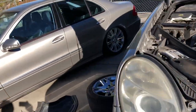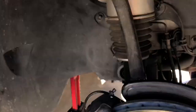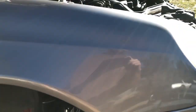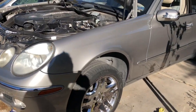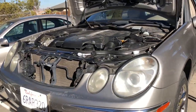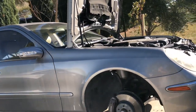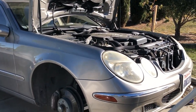I did this job without removing the front strut. All I did was loosen the top three nuts up here, then I was able to jiggle it around just enough to fit the wrenches inside — believe it or not. So I did not actually remove the air strut or air spring. This car has 160,000 miles on it and we just drive it around — it's nothing special, just something that gets me to the store. If it gets a ding in the parking lot, who cares — it's an older car and I just keep it maintained. Hope this helps you guys out — take care!